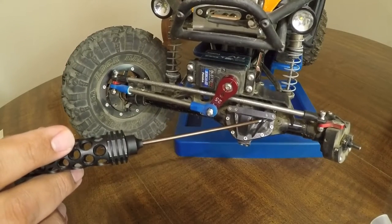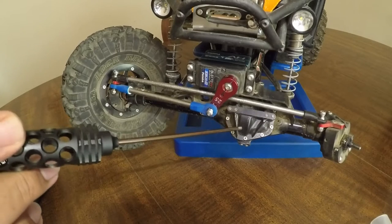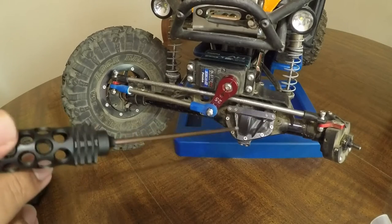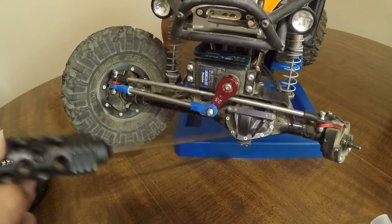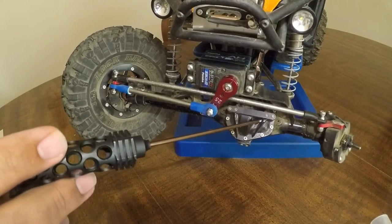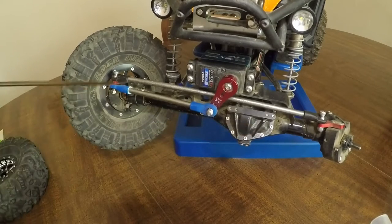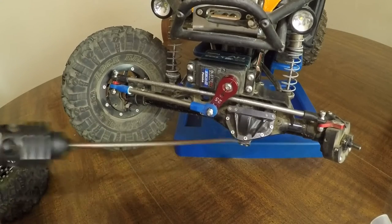In the pumpkin is the Vanquish Locker. The Vanquish Locker has two pinch bolts that pinch the ends of the axles on either end inside the locker, which are really nice. But if you get the standard axle universals, they are too short and they won't pinch down inside of this locker, so remember that.